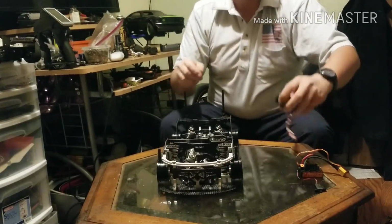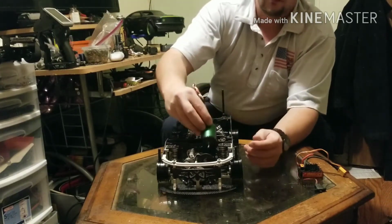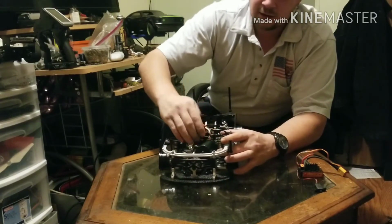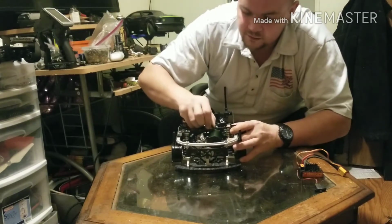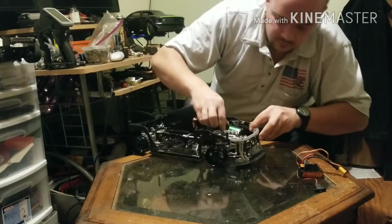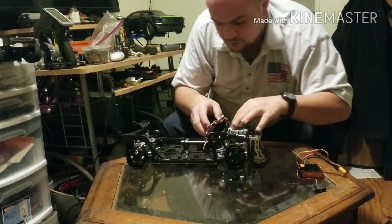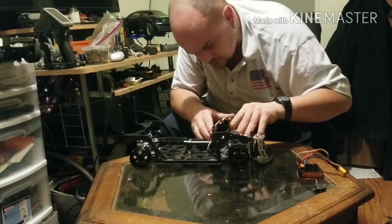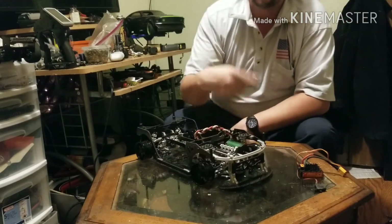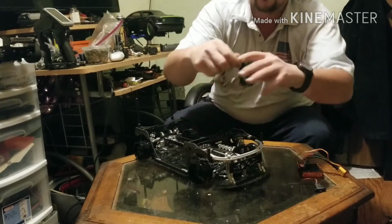The motor mounts, I'm going to do it with the wire up. I'm going to shorten these wires. But the motor mounts in like this. A 540 can is about the biggest that you're going to be able to fit in here. May be a problem right there. I don't know if it fits. Just barely, but it fits. So that's how the motor fits, but it's actually going to be upside down with the wires tucked in. Cleaner look, of course. More like this.